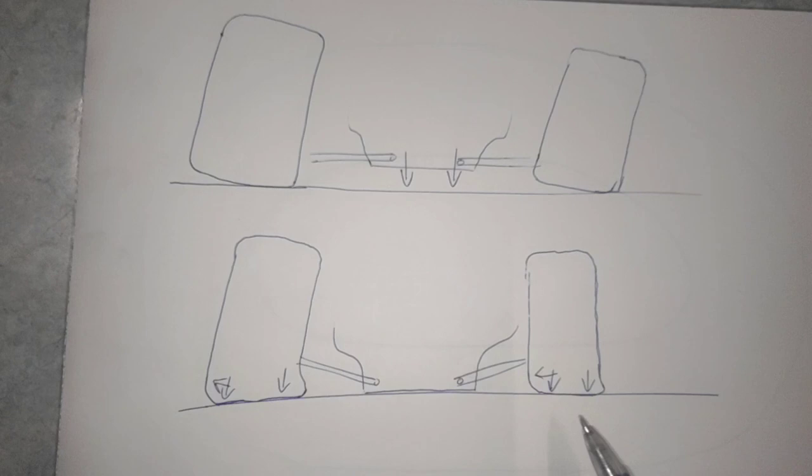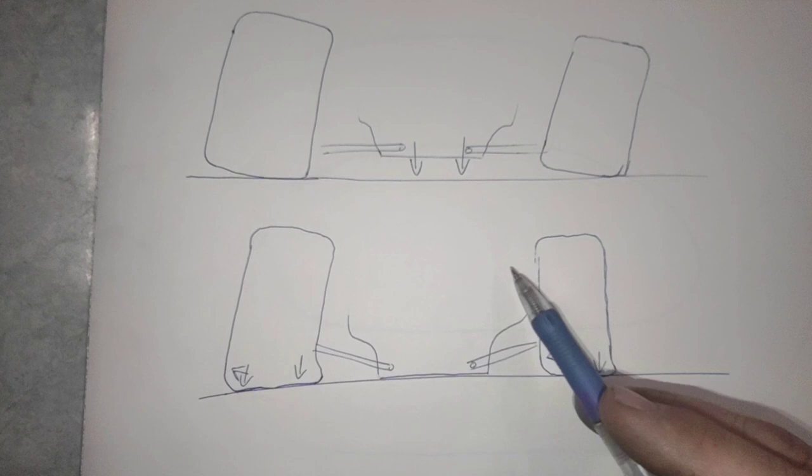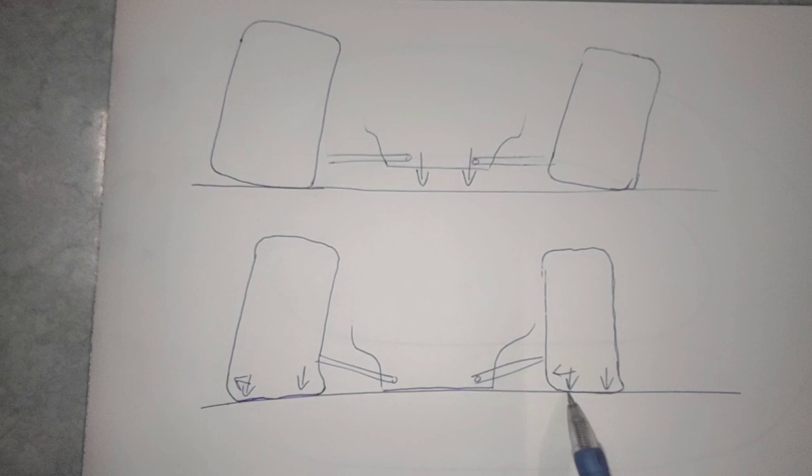Sometimes you see cars that are severely, severely over cambered on the left front, rolling through tech, but when they're on track, it's where they're at for their target. That's where they want to be. A lot of things like the geometry, the upper A-arm, more jacking force. You tend to run a shorter left front upper A-arm. You need more camber in that left front tire to get it to operate correctly in travel.